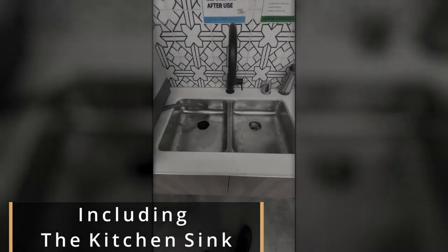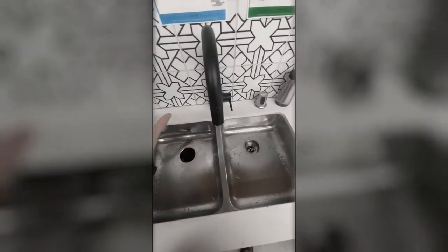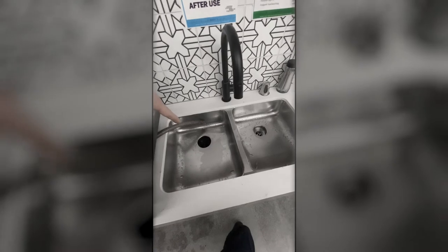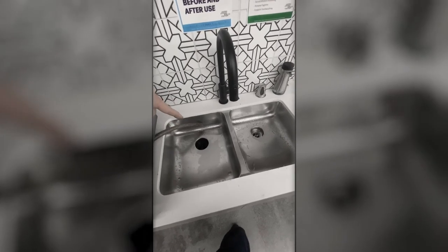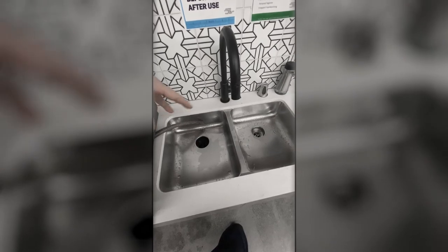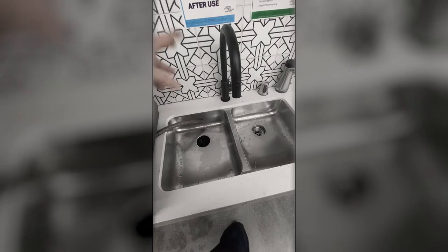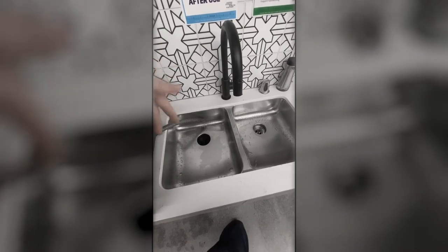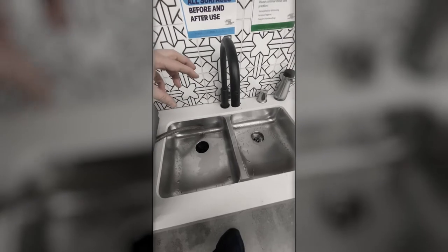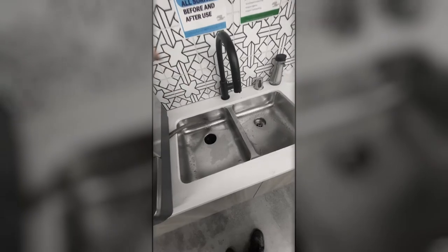I would also mention something about the maintenance of the sink. The tube goes into the sink, and so the grounds go in here, but every once in a while, be sure that you run the disposal. And I also recommend cleaning out with soap so that you don't get bad odors. Some people just put their lunch down there and they don't know where the switch is, and so you get gunk piled up. If you don't do the cleaning, then the sink will clog with coffee grounds and you'll have a mess on your hands.